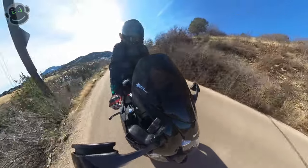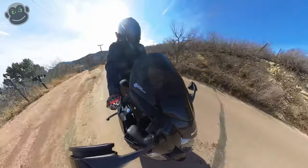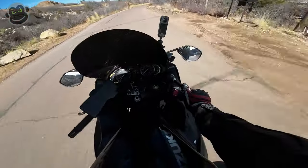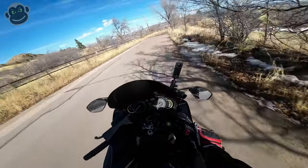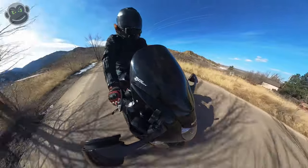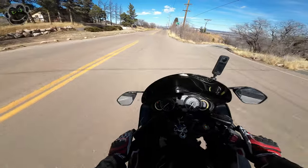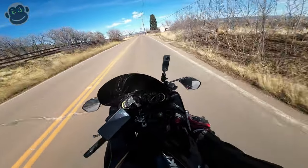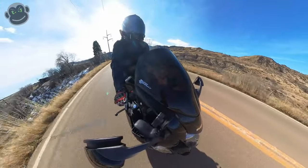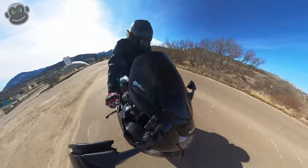Then I'm going to move on to trying to lighten the bike up further. You can remove 50 to 60 pounds off the bike with a full exhaust system, depending on whether you go with stainless steel or titanium — titanium obviously being more expensive. The two stock mufflers are like 20 pounds each — I weighed them in a video — so about 40 pounds just between the two mufflers. I replaced that with a single M4 and the carbon fiber muffler is like 5 pounds, so your net weight loss is around 35 pounds just with the muffler.